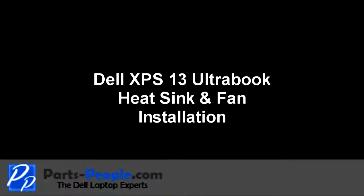You will need to clean the CPU and heatsink and reapply new heatsink compound before replacing the heatsink.